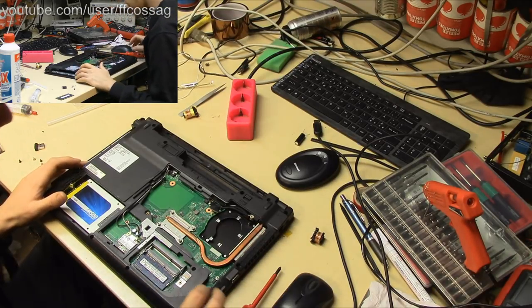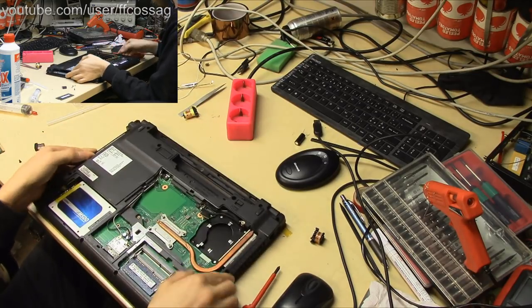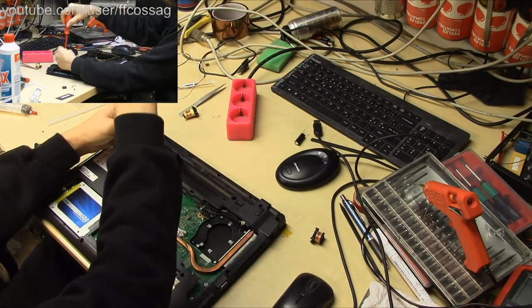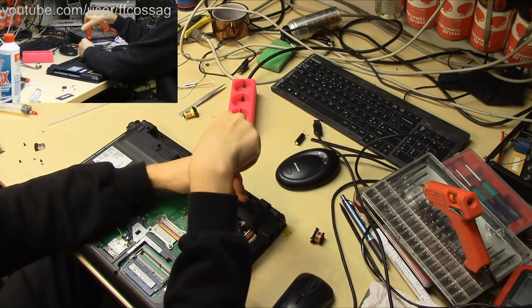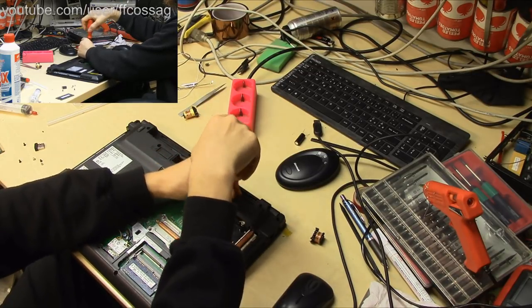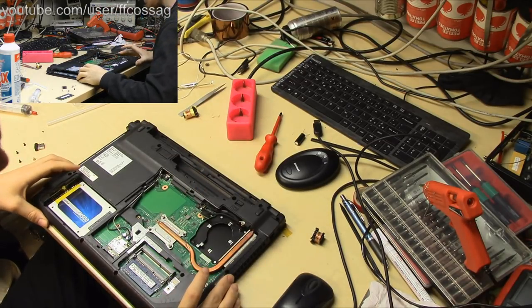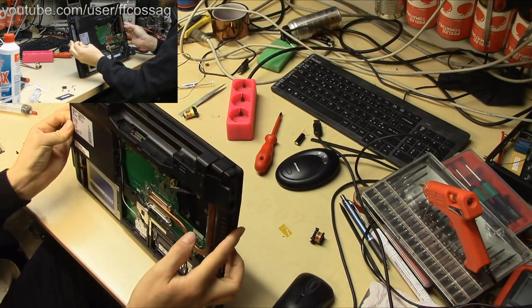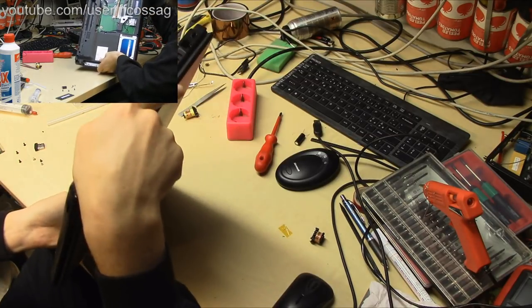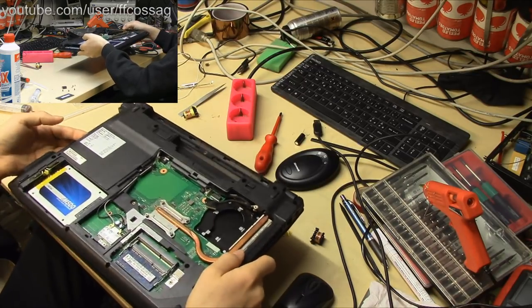It's got a 4th gen Haswell processor, i3 something or the other. So it's a reasonably modern thing, very power efficient. It's a low voltage i3. The model number of the CPU in this thing is i3-4005U. I think the U designates ultra low voltage. It's a 15 watt TDP processor, so it runs fine with no additional fan cooling as long as you mount the laptop vertically. It can even continuously run Prime 95 passively, which is quite impressive.